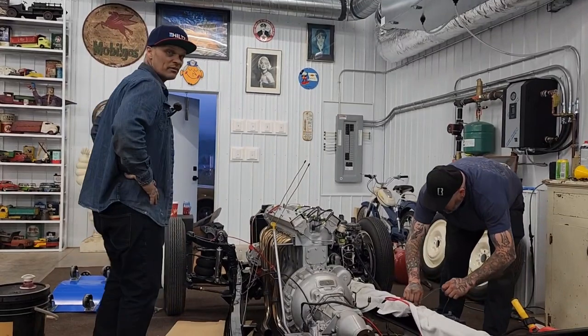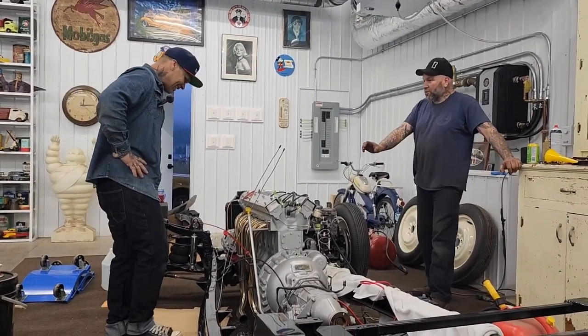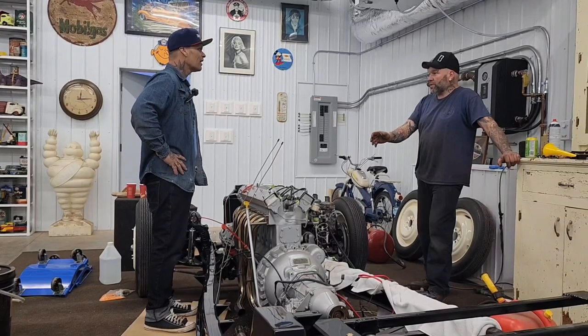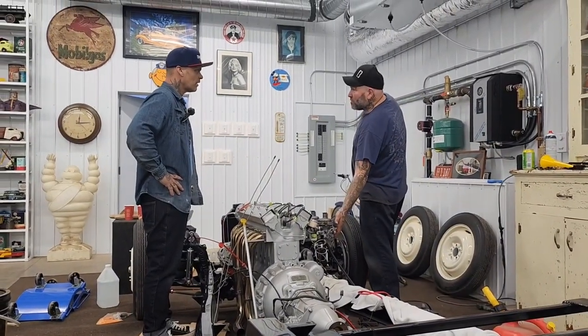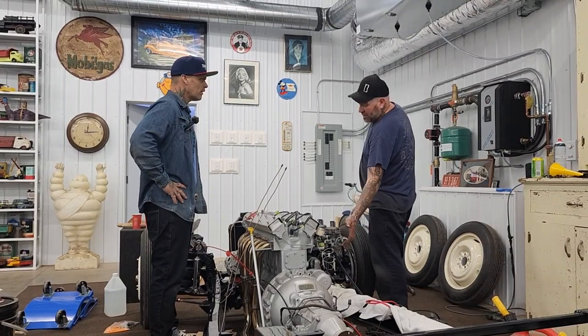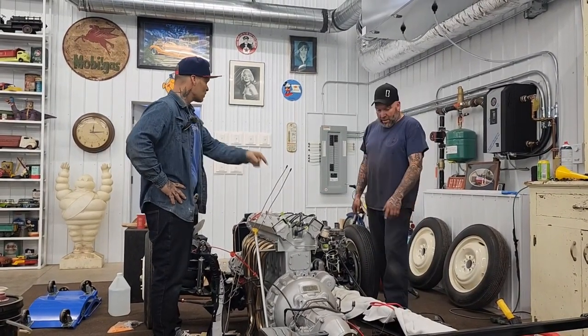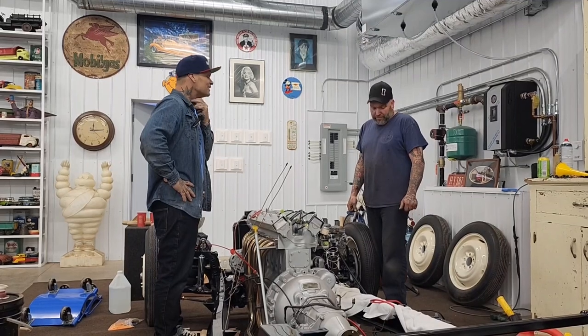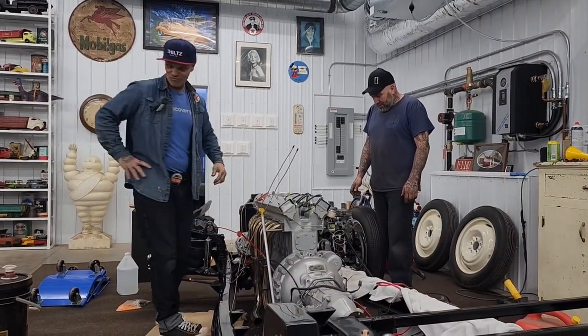There. Look out, boys. I might finish something. I see when you get half throttle now, from half throttle up, it's working perfect. It's the low end. So that low speed jet is probably a little bit dirty. So hopefully it soaks enough, it'll come around. It's not leaking fuel there. I had it right on and it was going good. So that makes me smile.